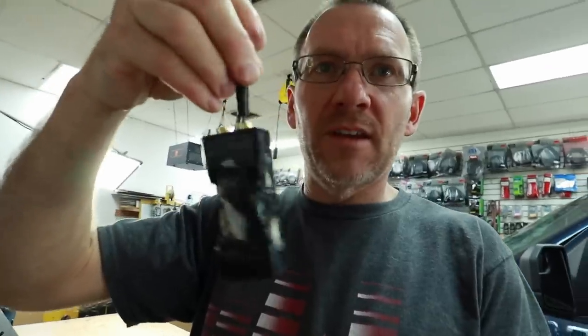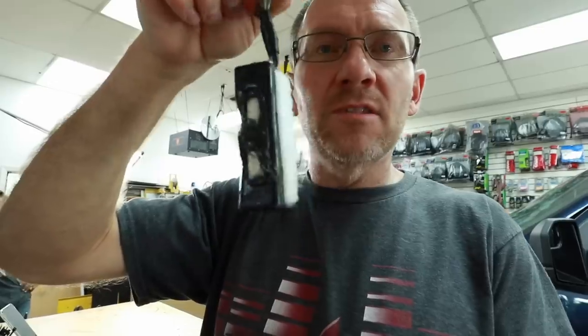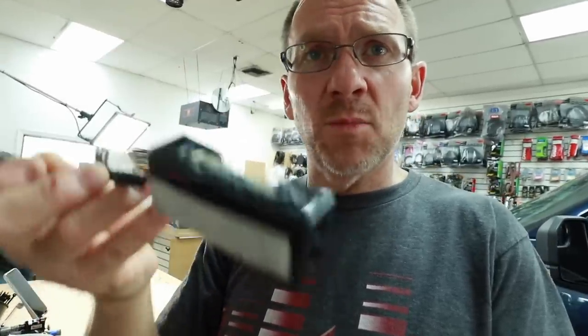High level is a totally different animal. It's going to be above five volts and can go all the way up to 40 volts depending on where you're tapping in. For example, a factory BMW amplified sub underneath the seat has a ton of voltage. If you get it wrong and don't know how much voltage is coming out of your radio, bad things can happen — like this high level to low level adapter here that somebody didn't measure output voltage on. This almost burned their car down. You can see the fully exposed circuit board — if this had been resting on carpet or your main wiring harness, that would have been it. Knowing how much output voltage you have from that radio is extremely important.